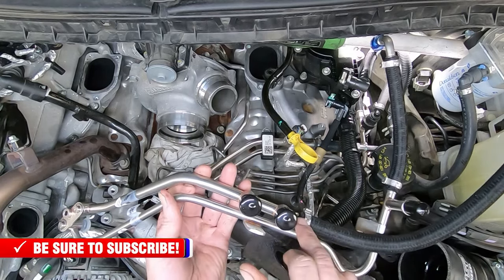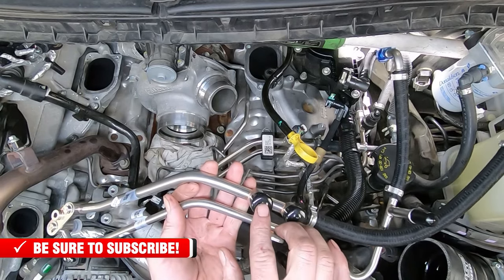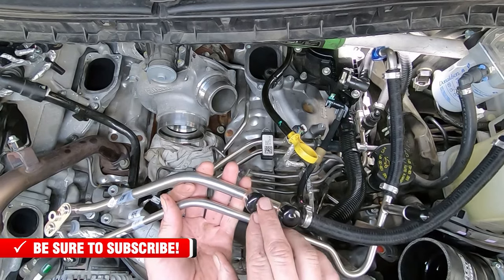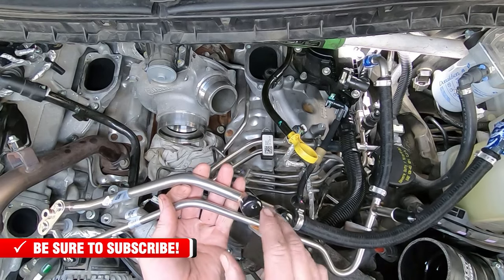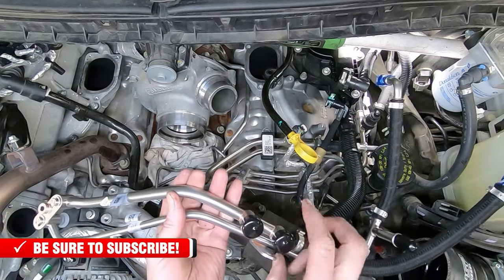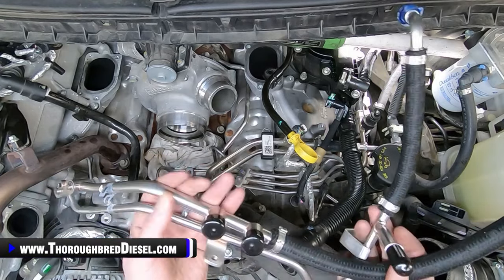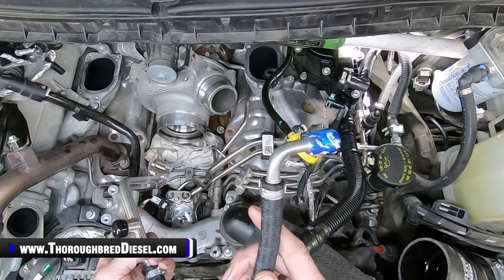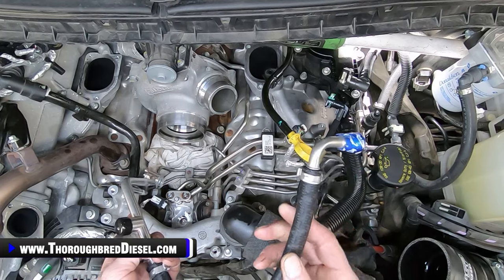And then these two ports, the two ports from S&S, work for different model years for your low pressure fuel sensor and then temp in certain years. This one only has the one sensor on it, so we'll be plugging one of these and I'll show you that on installation. But I wanted to show you what these lines were, and I kind of direct you towards our return line here. So the return line goes back and ties in on the rail.